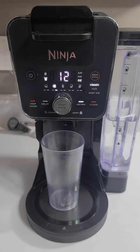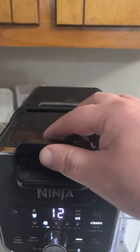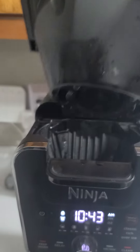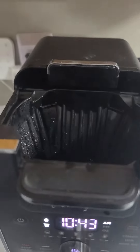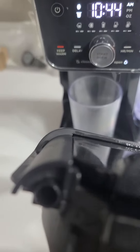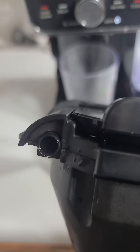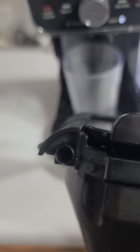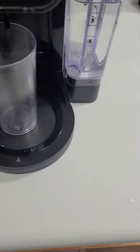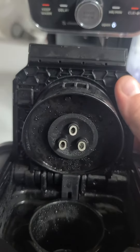So I decided to check it out. What I found is when you take it out to make the full pot of coffee, everything works fine. The water comes through that hole right there, as you can see it. I don't know how, but over time that hole had gotten packed up with coffee. That hole is what feeds the water into the cup.